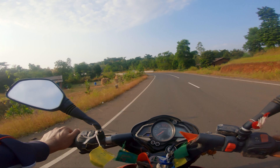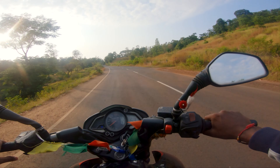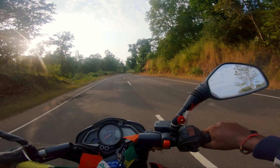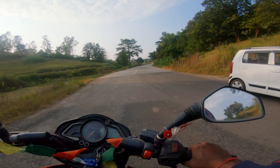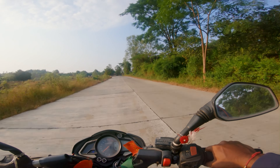In such a scenario, the wheel spin measuring sensor on the front and rear wheels — specifically the small ring inside the disk — measures how fast the front wheel is revolving. Taking the front wheel spin as a reference point, the rear wheel spin is also measured by the rear wheel spin sensor. The values of wheel spin from both wheels are sent to the ECU, which computes and compares the rear wheel spin against the front wheel spin.